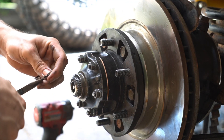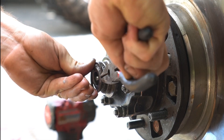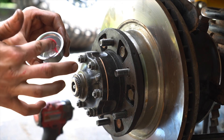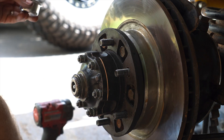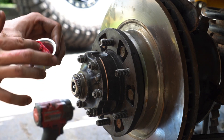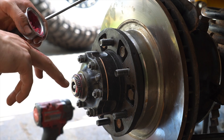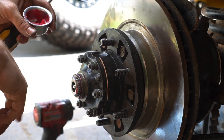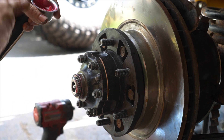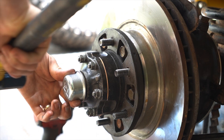Wipe off all excess grease on our sealing surface as we prep to get our outer flange on. Go ahead and get our new seal provided in the rebuild kit. Pick up your flange, make sure the surface is nice and clean with no old gasket or debris stuck on there. Now with that on there, we can start putting all our cone washers, washers, and nuts back on. Tighten these down to 20 foot-pounds. You'll see some varying torque specs online — some people suggest 26, but I think 26 is a little tight. Honestly 20 is borderline tight. After all, this is just a small stud, and with the lock washer in the cone washer they're not coming loose. Then get your snap ring back on with your snap ring pliers.